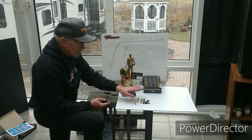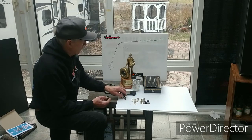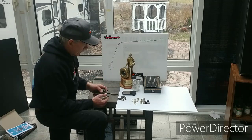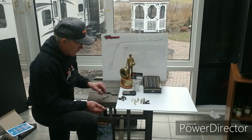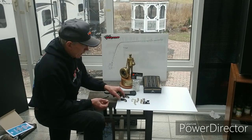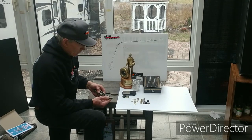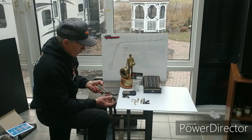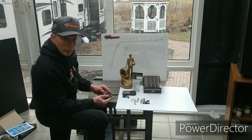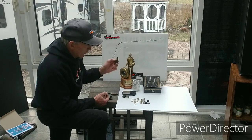Guys, this looks like a lot of stuff, but it's a lot of neat stuff. Any of you guys just thinking about it, watch this video one more time — super easy to adjust. Because I also promote hill races, we have the biggest circuit in the country, 30 events usually each year. I'll be running a race and the temperature will change from 20 that night — it may go to 5 below zero. All I will do before I go up the hill is turn this in 3 or 4 turns, and basically I've got another half a gram on my tip. My RPMs will be correct. Very nice setup.